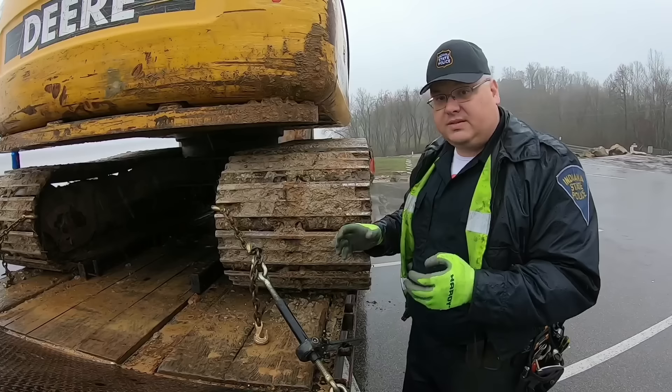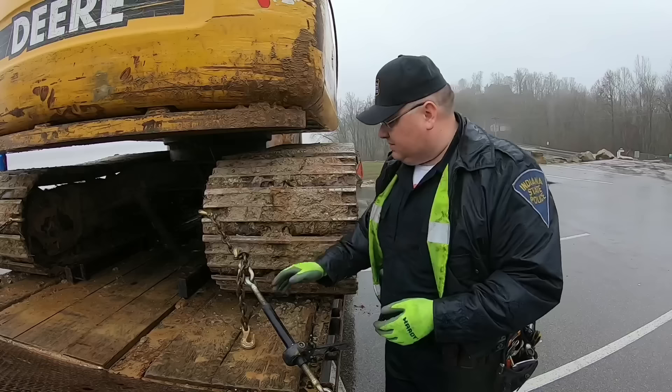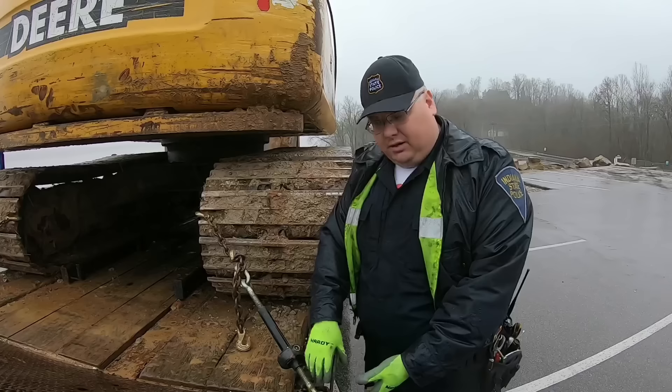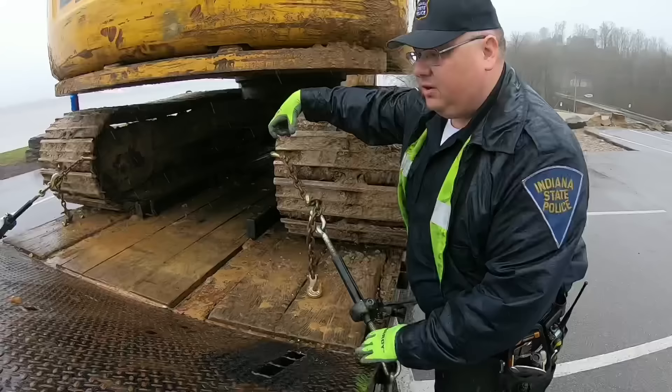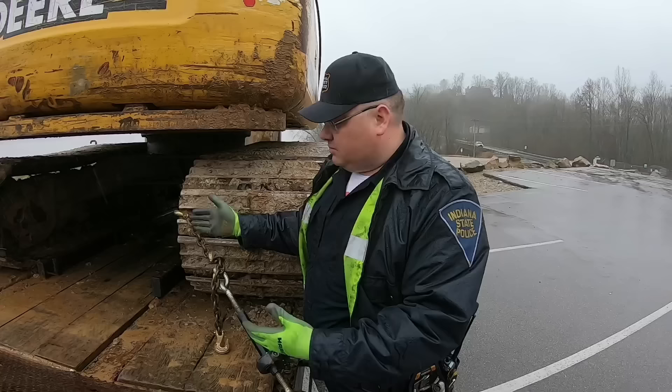When you look at 393.130, it says minimum four tie-downs. If you really want to learn about it, go to 393.100 and read it all the way through. Whatever securement devices are used, they have to have proper damage-free mounting locations. Some newer equipment may have manufacturer-rated tabs or hooks on the inside — you can utilize those as well.